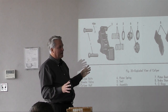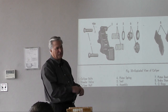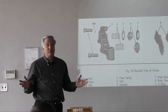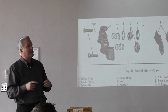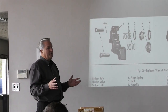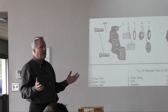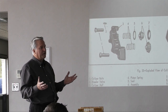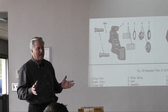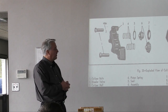I know people in the rebuilding business — none of them use the special sleeve drivers. It works pretty simply. You just have to keep the bores clean. If you've got stainless-sleeved calipers, you should be good for life. The corrosion won't pit the bore — that's the nice thing about a stainless-sleeved caliper. You can clean them up, put new hydraulic seals in, and you're off and running again.